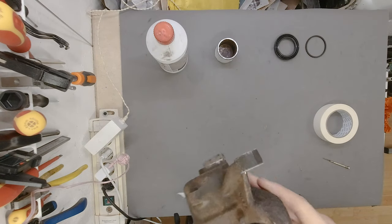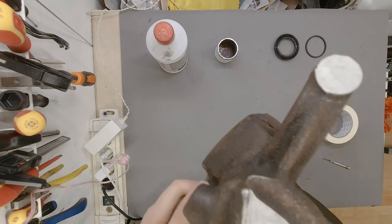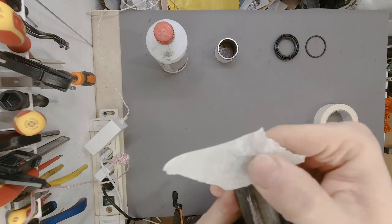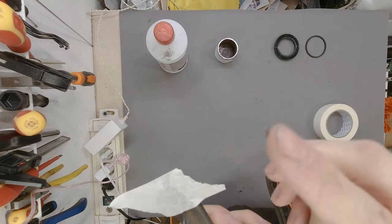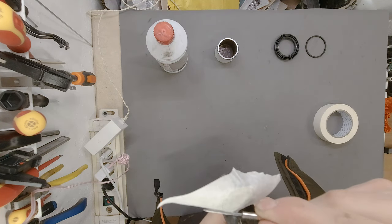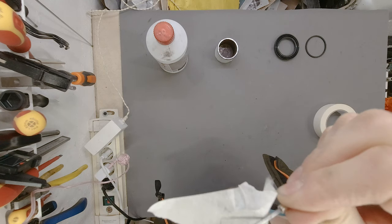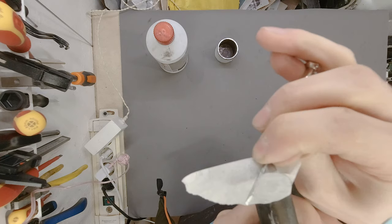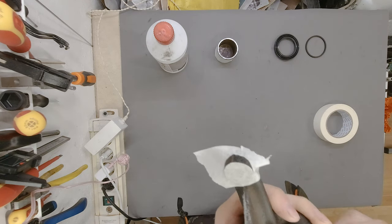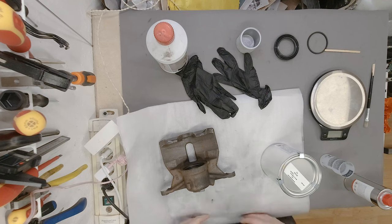Just wanted to quickly show you one more time because I am really surprised just how professional this looks. Look at this masking job. Everything is so precise, and what you do is, of course, take a masking tape, make sure that it's on, and then use whatever round surface you have. So I have a screwdriver, and I just go around the corners like this a couple of times with a medium pressure, until like this. I don't know if you can see that. Until it is off. Amazing, isn't it?